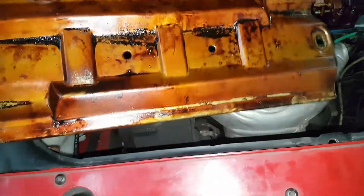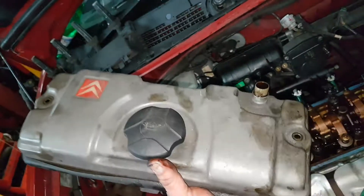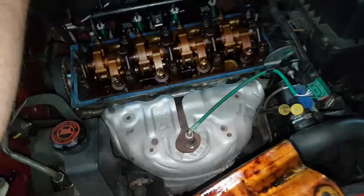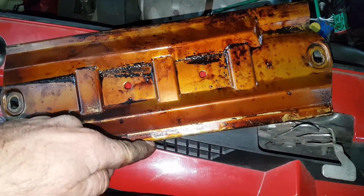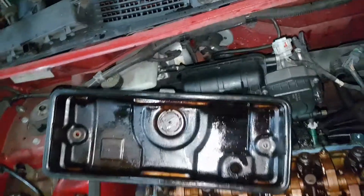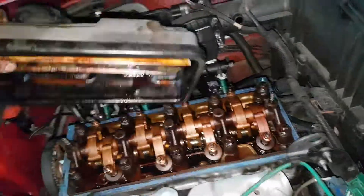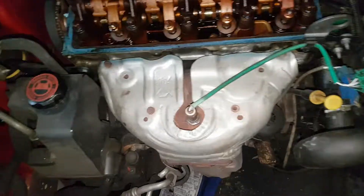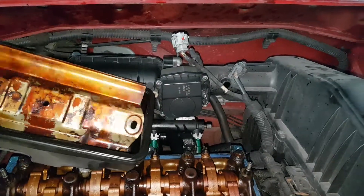If I use trial and error and look very carefully — see this lighter bit here? That bit there is longer, and all of a sudden it appears that one is longer than the other — and that's just the beginning. Telltale marks: when you mix bolts up, when you mix washers up — see that? That's married into that surface. So I went to misinstall it deliberately. It's not easy to misinstall it, but this is how you do it. I get the rocker cover the right way around. We've got the shorter bit there and the longer indentation there, so we marry them up.